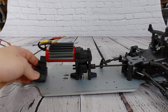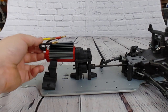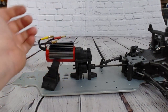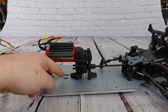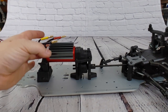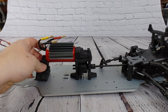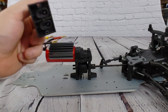This bracket here holds the motor down and keeps it from going down, but I've landed violently many times on the roof and when you land on the roof there is no motor support. The only thing in there is a thin plate of metal wrapped around plastic, and what I was doing was actually bending mine up a little bit. The M2C piece is not only a stiffener that attaches to the rear end of the motor, but you can zip tie it down to the actual motor so you're holding the motor down to the mount instead of just letting it flop and hang in there.